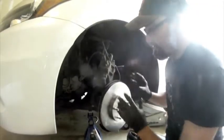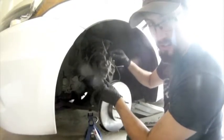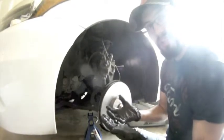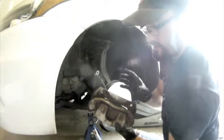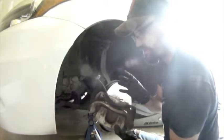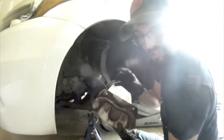So we're going to go ahead and put the caliper back on because we can take this cradle or carriage off while the caliper is mounted. However, it's actually going to be kind of hard to mount the caliper because the new rotor is thicker — the caliper was set up for the old thinner one. So we're going to have to compress the caliper piston to get it back on.